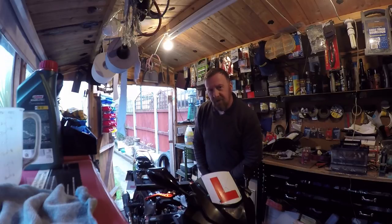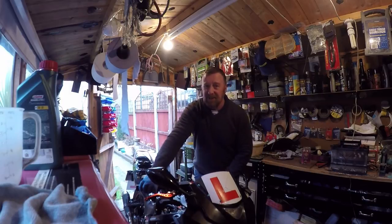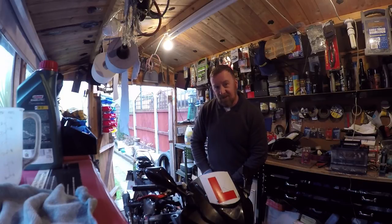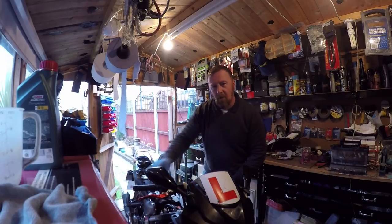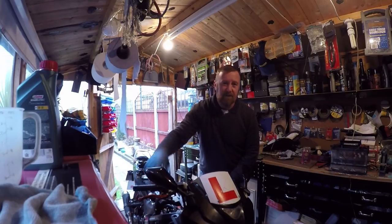That seems to be it — it's definitely running a lot better and ticking on its own steam. I'll check the plug, and if that's a nice colour I'm going to put it all back together and take it for a ride. Even when it was running really rich it did run well, so having more air in there may make it a little bit weaker — but that's what you need a bike to start and stop. So it hasn't finished there — even when I put all the panels back on and start again, I've got to wait for tomorrow morning to see if it starts, because when I put the choke on it was dying really badly and wouldn't start. If it's not right, another half turn out, or it'll be a new carburettor. Hopefully that's explained how to tune 4T carburettors to the best I can show you. Please like, share and subscribe, keep watching my videos. Take care if you're on the road.